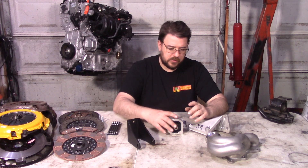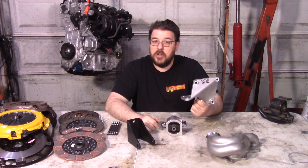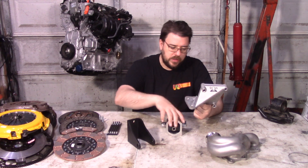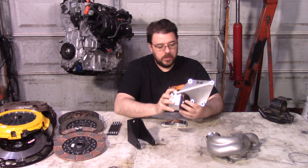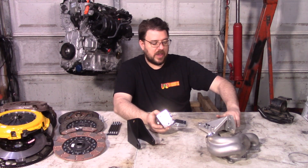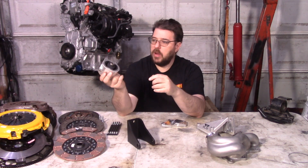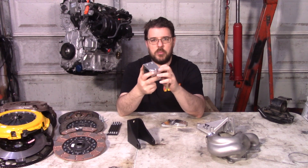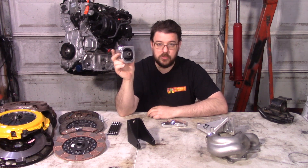Now let's talk about the 2AR. This mount is the mount that I developed for the Project EV — the one where I'm making the drag car that I'm planning on taking the naturally aspirated record with. This is now available. This basically allows you to mount a 2AR right into a second-gen Toyota MR2 using a rubber mount, because I absolutely hate polyurethane. Rubber does a much better job at isolating the high-frequency vibrations that are annoying in a car, and frankly, rubber mounts aren't that much harder to make.